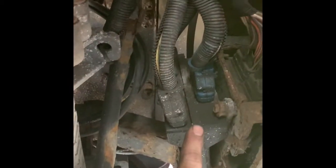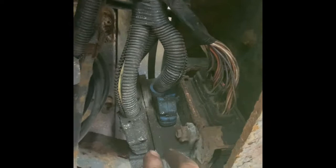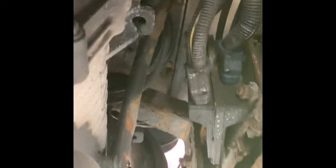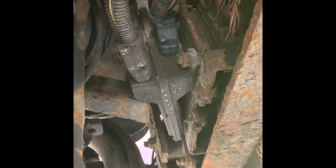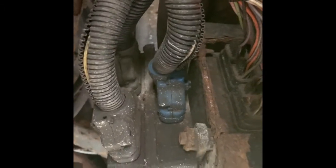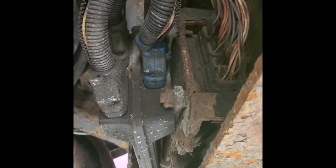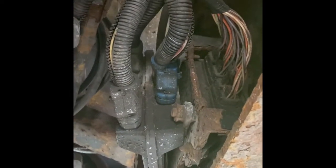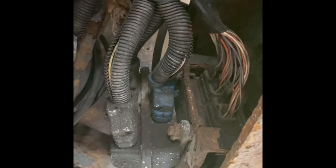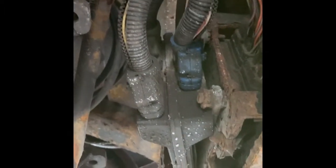This module on the outside here is your ECU. This is the VIM — vehicle interface module — which takes all your inputs from your vehicle like power from the battery and sends it to the ECU. I want to start by checking power and grounds to the ECU. That's going to be on the gray connector, which is the V connector — pins V1 and V16. Check for power on the pink wires first, then check the grounds on that same connector.